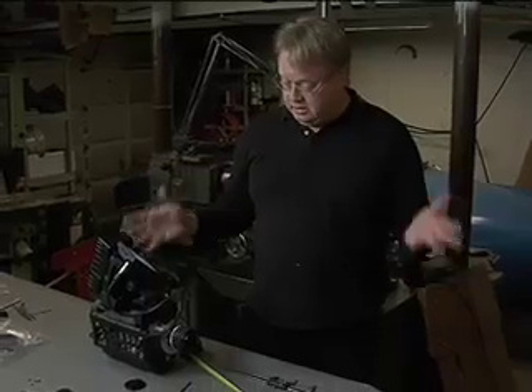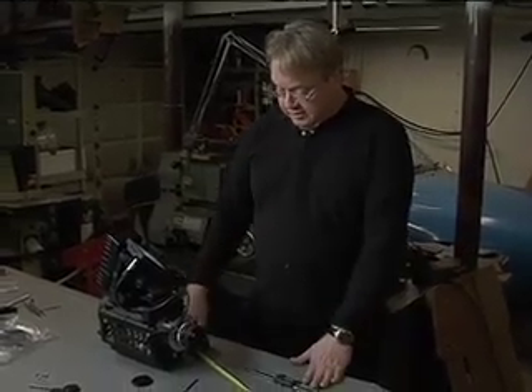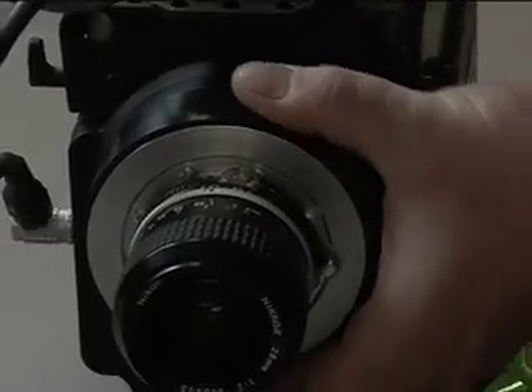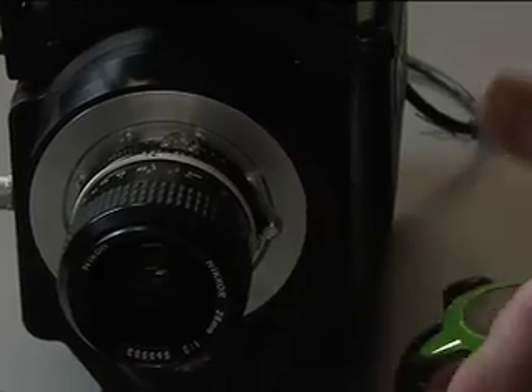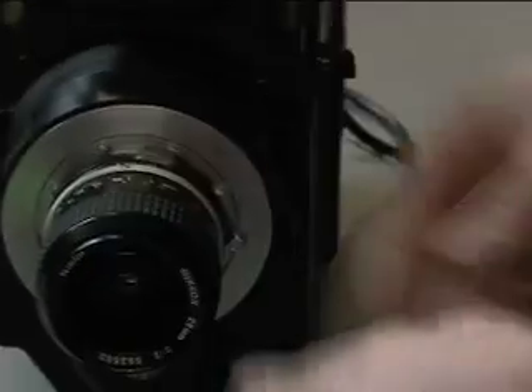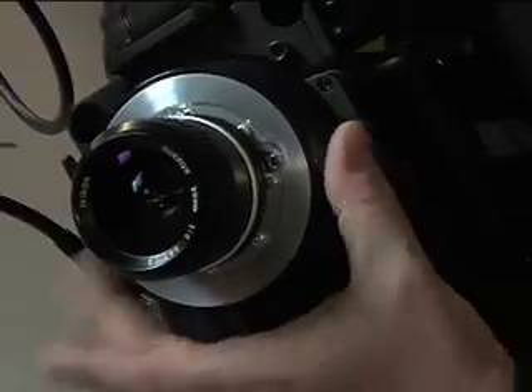We're here with the final step in putting a Nikon, or really any other mount, on your RED. We have to set the flange focal distance. RED has supplied this wonderful adjustable mount which moves the whole existing lens mount in and out, making it very easy to do. You take a four millimeter hex wrench and loosen these two hex bolts, and you're able to turn it in and out to get your final focus.